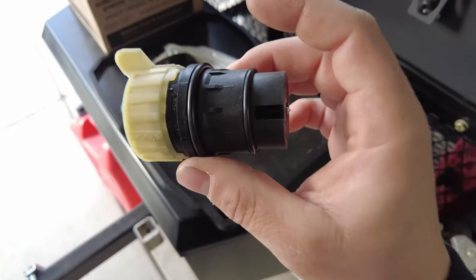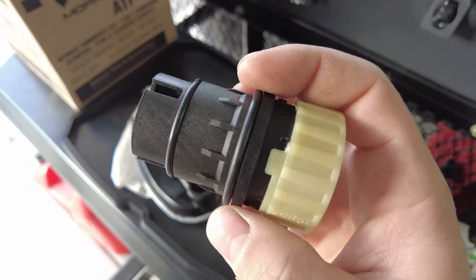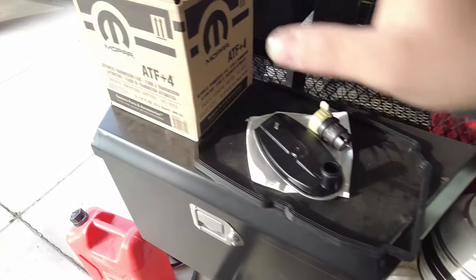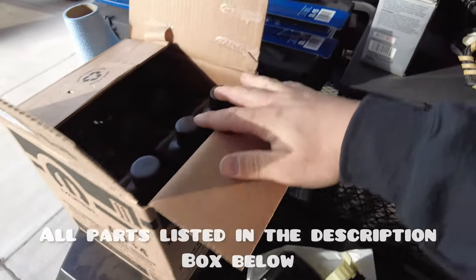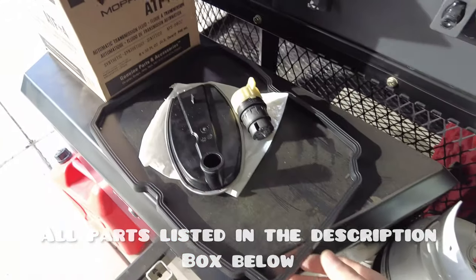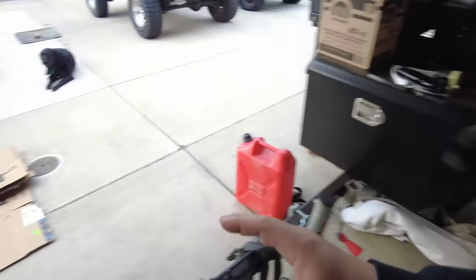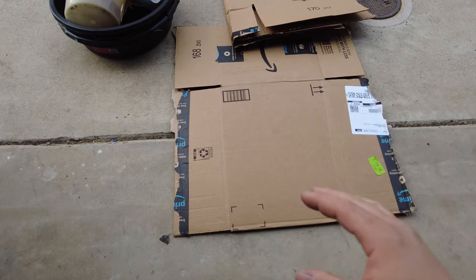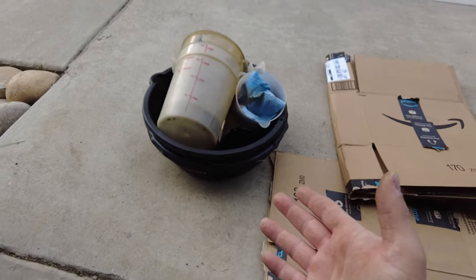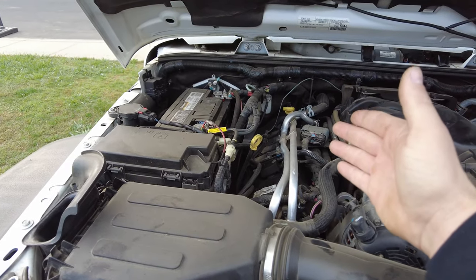This is called the electrical harness plug adapter, which a plug sets in here. This part seals the transmission and these O-rings fail. So we're going to be replacing this while we're doing this pan flush service. I've got the Mopar ATF Plus 4, six quarts in a case shipped to my house for $55 from Amazon. Over here, I've got the pan gasket and filter for the transmission. I've got some cardboard to catch any leaks, some basic containers for catching oil, a measuring cup, and the hood propped open so we can access the dipstick for the transmission.